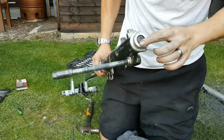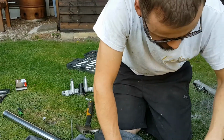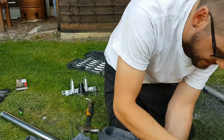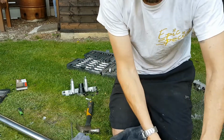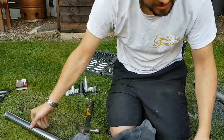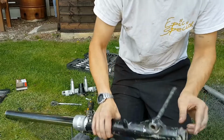But now that spring's in there, that'll be adding tension, so you can nip this bolt up on the bottom here. Pulling funny faces. It's still turning on the inside, so I might have to bring home my little impact gun just to nip it up. There is a special tool that actually holds that damper unit inside, but I don't have it because it has to fit all the way down here and locks into a 12-sided sort of hex pattern on the top of that damper unit. But if I just get an impact gun, whiz it up on that, not tight obviously, but it'd nip it up quicker than I can, that'd be good. But for the time being, that's absolutely fine.